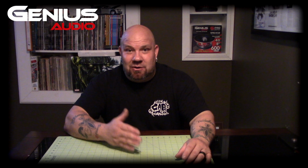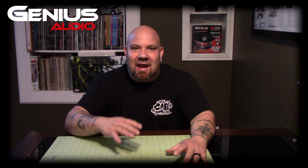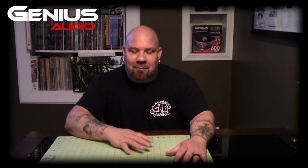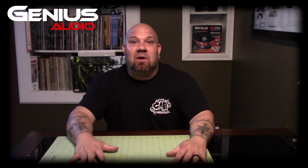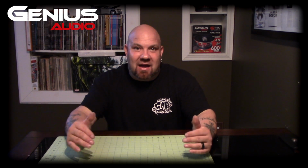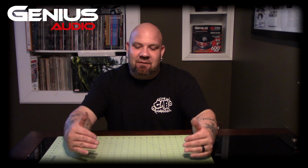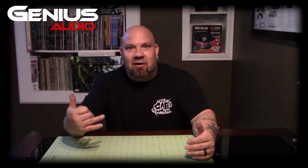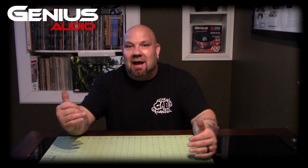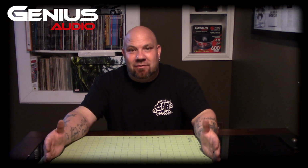All right, I produced over 2,500 watts at 10 volts. So that amp is a kick-ass amplifier, but it is a lot of power and it requires a lot of power. On the bottom side of the amp, there are fans. So I did notice you do have to elevate the amplifier. If you don't elevate it, you're gonna have to do a cutout underneath for air circulation. I had it sitting on the bench and the amplifier was getting very warm through testing.